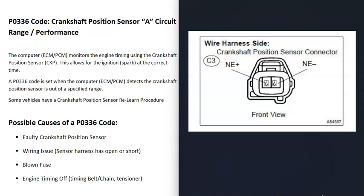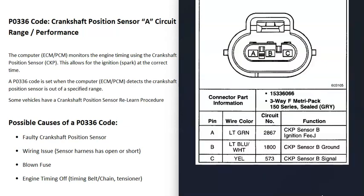There can be two-wire sensors, three-wire sensors, and some newer vehicles even have four-wire sensors. Three-wire sensors are pretty common. Basically, when you turn the key to the on position, you're going to get voltage to it — usually around five volts — and then you'll have a ground wire and a signal wire going back to the computer. Every time there's a piece of metal directly in front of that sensor, it sends a signal back to the onboard computer. Be sure to get a diagram or schematics for your particular vehicle to know for sure what's going on.